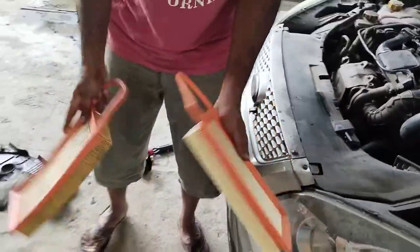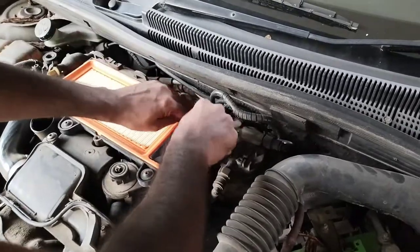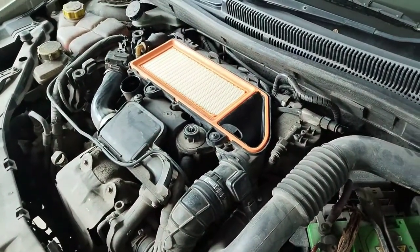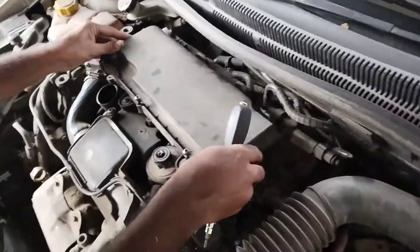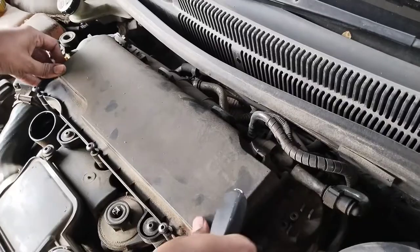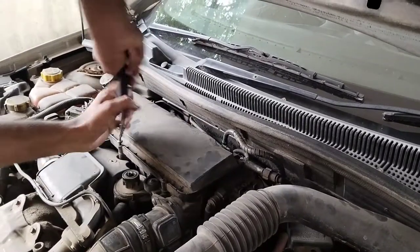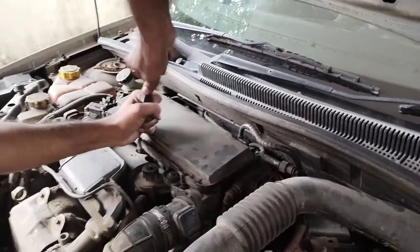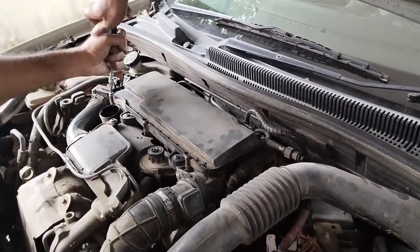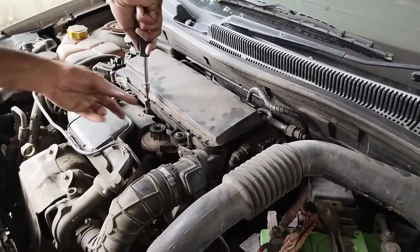You can see why we needed to change the air filter now — it's a straight fit and sits perfectly in its location. Next, place the air filter cover back. Before placing, note there are three clips at the back — one, two, three — and the same three clips on the front side. Place it in the right location and just press it; that's it. Now just screw them back with the same T20. Air filter replacement is done.